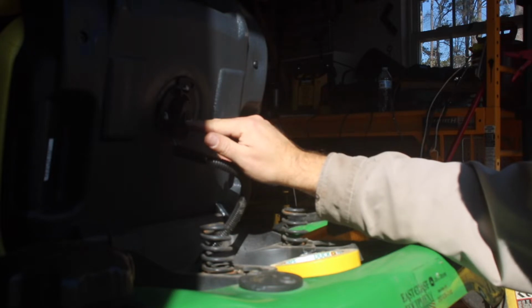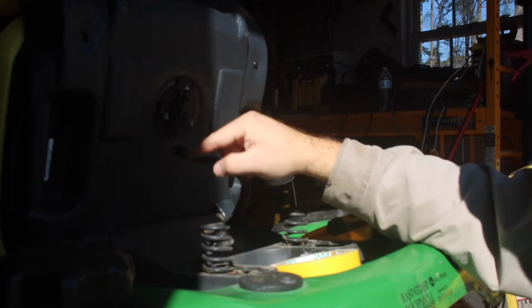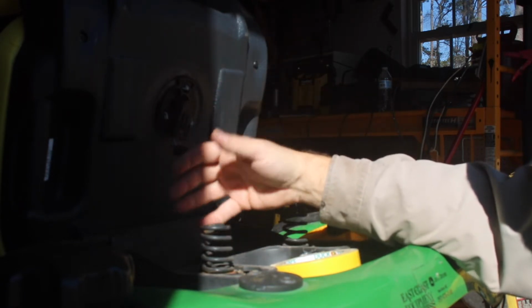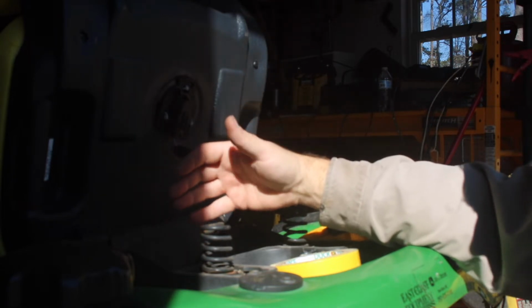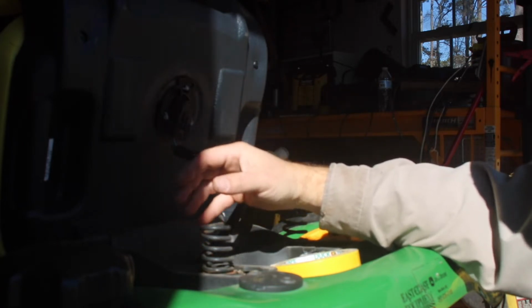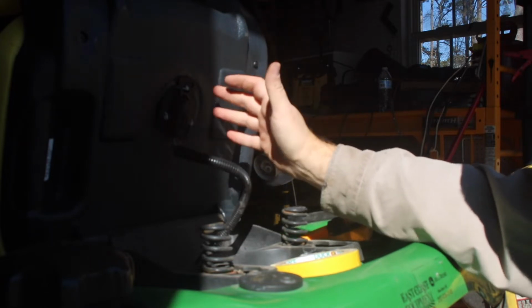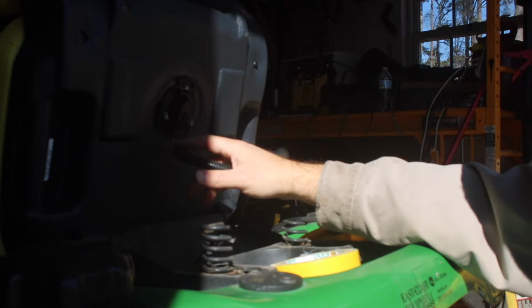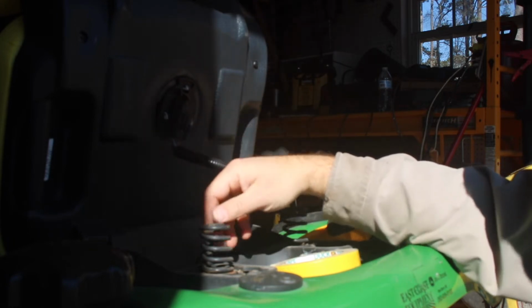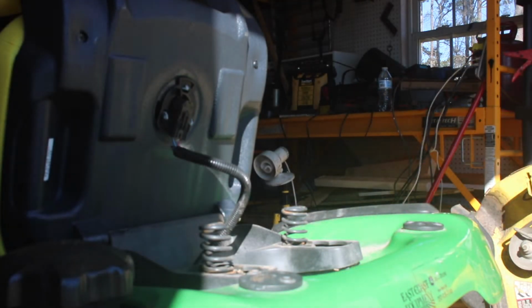When it comes to black electrical tape or anything like that, you really don't want anything that's going to hold moisture. I've had connectors that have had black electrical tape put on them, and moisture will still find its way in there. I think the best way is probably to hermetically seal it, or to use some of that liquid electrical tape that you can dip the entire connector in, a waterproof rubber that is going to protect it. But I have had more bad luck with actually just taping things, because moisture will still find its way in there and it can't drain out. Whereas with this, if moisture does get in there, like you're pressure washing or whatever, it's going to be able to dry itself out, which is going to make that switch last longer, and it's not going to get corroded. So I'm going to leave it, and I don't think it's going to be an issue.